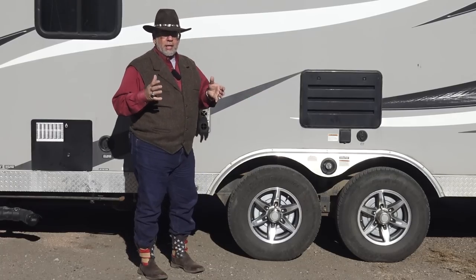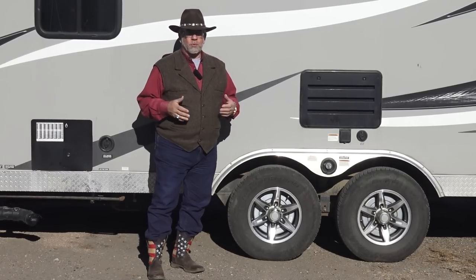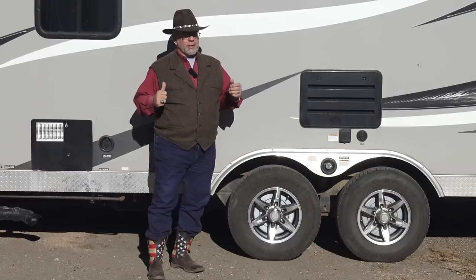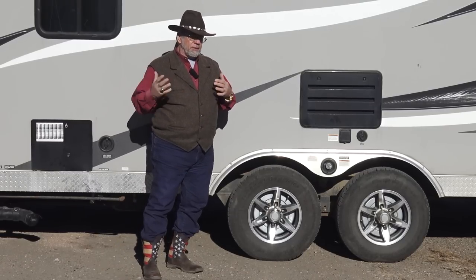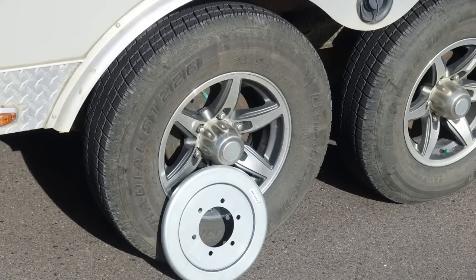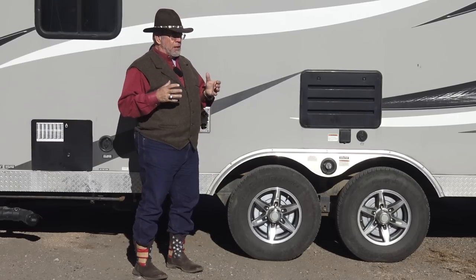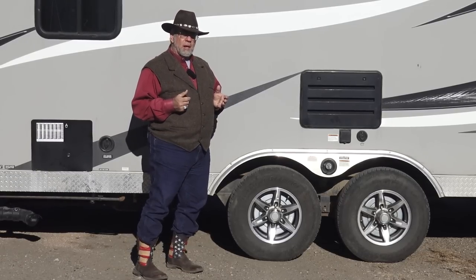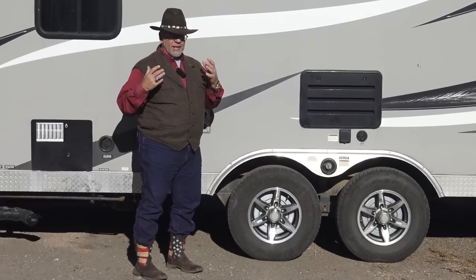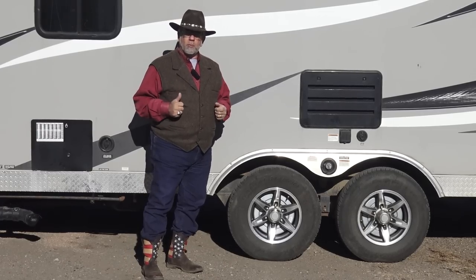Because your tires aren't shaking so much — they're balanced now — they're not going to cup on you. They'll actually last 25 to 50% longer, which is a big deal. That's why so many semis use these. It's big in the owner-operator truck business. Now, the 14-ply tires I have on some of my trailers make them ride a little rougher but flex less. It's the flexing that creates the heat from low pressure. If you can keep them from flexing, you'll have less heat, and if you keep them balanced and prevent cupping, heat — the number one problem with trailer tires — is reduced.